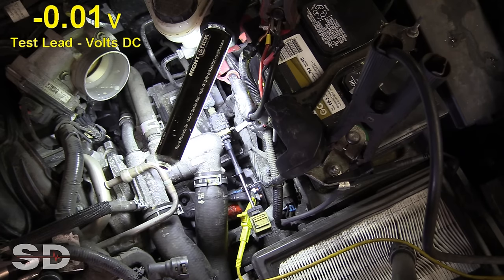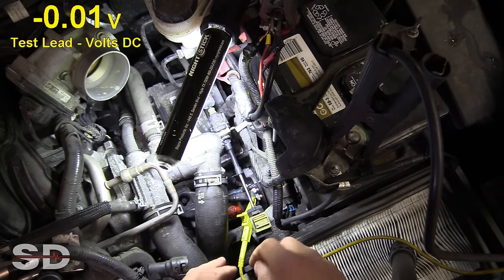One other piece you want to be careful of: I'm measuring on the stud. We might not have a cable issue — although we know we do in this situation — but what you'd want to do next in a typical situation before you say the cable is bad is go to the eyelet of the starter. We now want to go on the area attached to the cable, not the stud, because we could have an issue at this connection right here. You can have an issue where the eyelet is good but it's not making contact with the stud itself. Go ahead and crank that — hold it in the crank position. You see the same voltage drop. That means our connection at the eyelet and at the stud is good. Our problem is up this way toward the battery. We have a cable issue, and for sure with the melted air cleaner housing and this Mickey Mouse setup, our issue is right there.